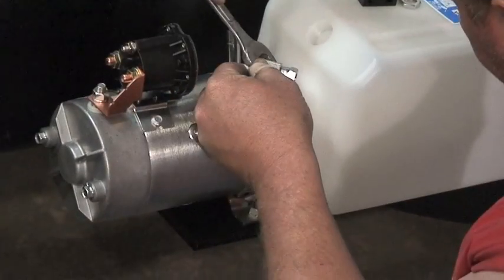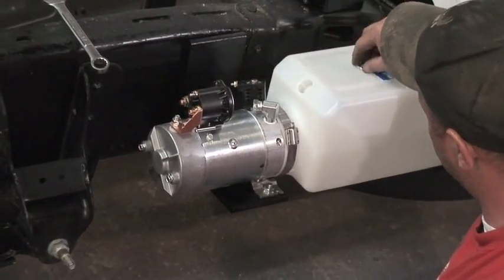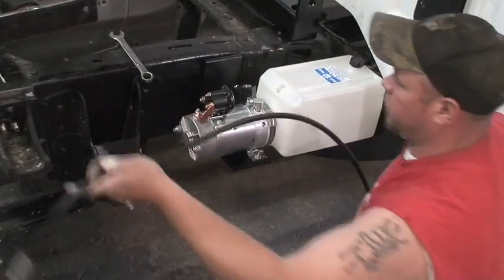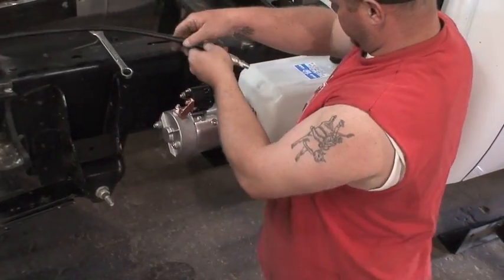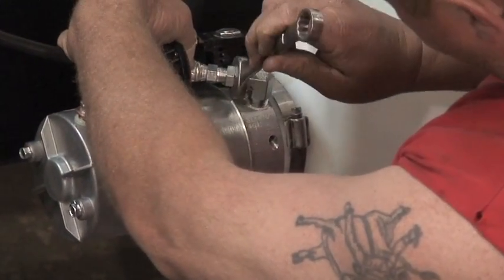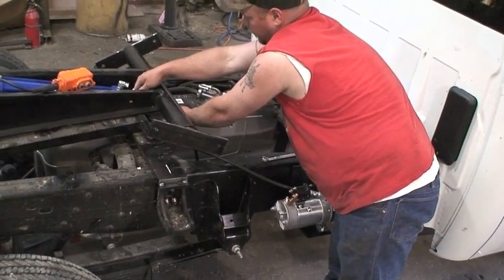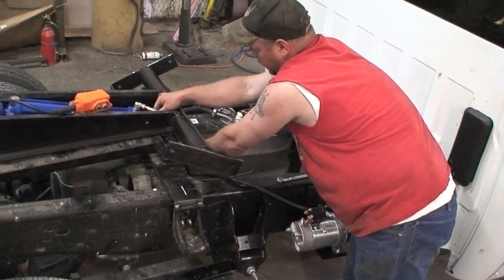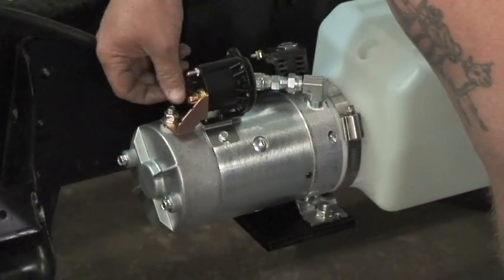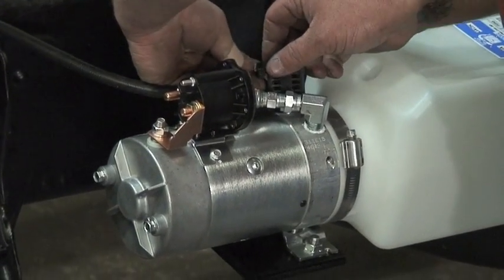When you tighten the 90-degree L, it has to be installed pointing in the correct direction so the hose doesn't contact any other hardware. The hydraulic hose can then be run to the scissor assembly cylinder, which is located inside the scissor assembly. The hose should not be in contact with any muffler, tailpipe, driveshaft, or any moving object like a spring. When installing the black coil back onto the valve stem, the nut is to be installed on top to hold it on — snug is tight enough.